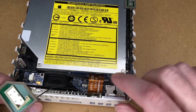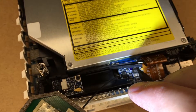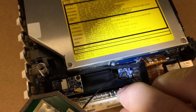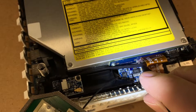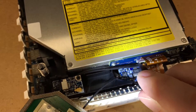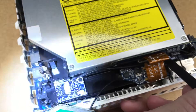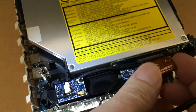Next we need to remove this cable. I'm shining a flashlight on it. There's a little tab right here — you have this ribbon and this tab, and you want to push up on this just a tiny bit to release that cable. I'm putting the spudger tool under it and just lifting up. I'll do the same to the other side, and this should lift right out.